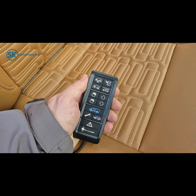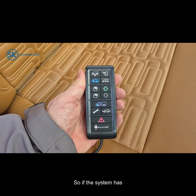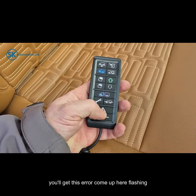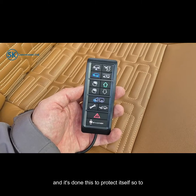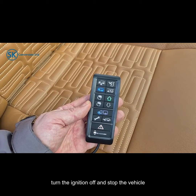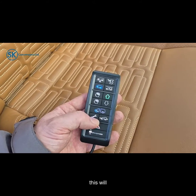The off-road mode — the system is now working itself to off-road position. I've triggered a warning, so if the system has developed a fault, more often than not it will be over-temperature. If you have been going up and down the height settings for a prolonged period you'll get this error — a flashing red triangle. This is telling you the system is now in error mode, done to protect itself and prevent damage to the components, namely the compressor. The next time you turn the ignition off and back on again this code will reset itself and it won't come back on unless the parameters of the error are met again. If the fault state is still there, this will flash again.